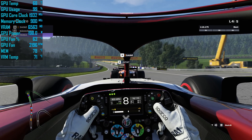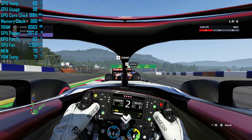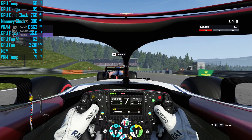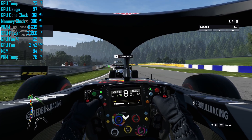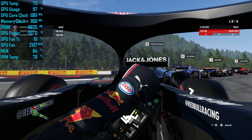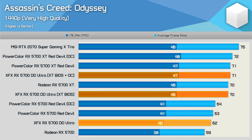This isn't a guide on how to do it, but there are plenty of guides online if you want to flash AMD graphics cards. In this instance, I went from an average operating frequency of 1810 MHz up to around 1920 MHz once the XT BIOS was installed — a 6% frequency bump. With the XT overclocking limit now unlocked, I was able to push the GPU up to around 2 GHz, a roughly 10% frequency boost. I also overclocked the memory to an easily achievable 900 MHz.